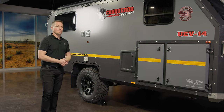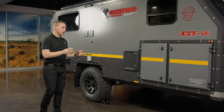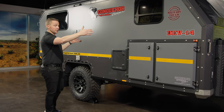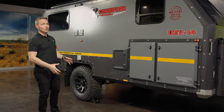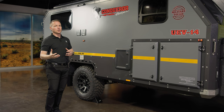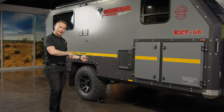You've got a couple of water tanks under here, independent of your grey water — an 80 litre and a 120 litre freshwater tank. Two separate independent tanks with a valve that swaps between the two. Those tanks have steel guards around them for underbody protection, because you don't want to pierce your tank. In the off chance you hit a really sharp rock and one tank is ruptured, well, that's okay because you've got a second tank.